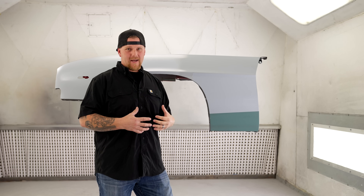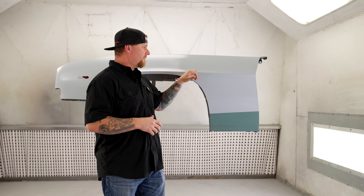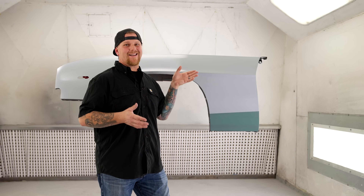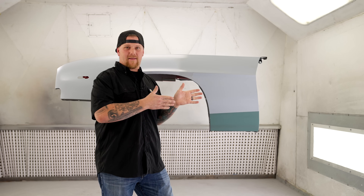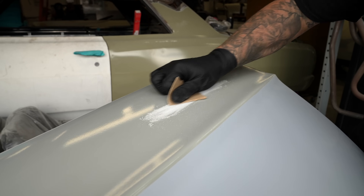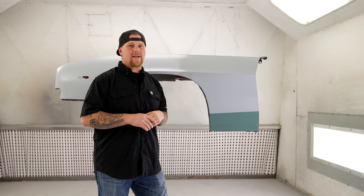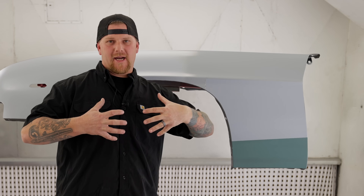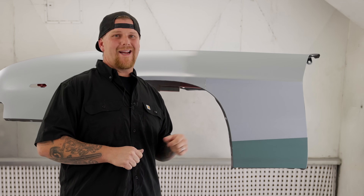When we talk about epoxy, there are different varieties. VP-2050 is considered a DTM — direct to metal — but they call it a DTM high-build, which is a hybrid, meaning it's an epoxy primer with a thicker build so you can actually come in and scuff it without it getting gummy in your sandpaper. Most epoxies are known to not be sandable, but VP-2050 is, and that's why it's such an awesome product. It's very strong — it encapsulates everything, and because it's so strong, it protects against rock chips, door dings, and similar damage.